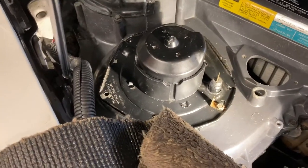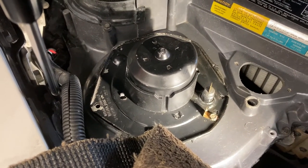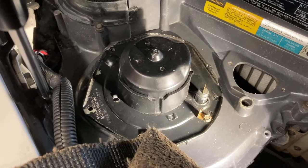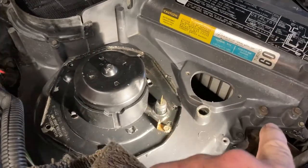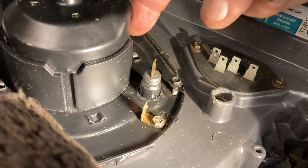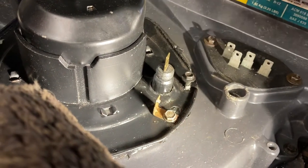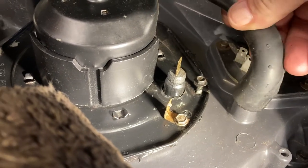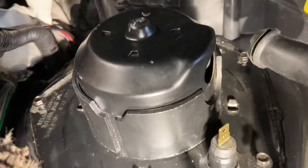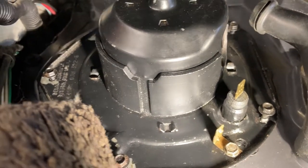So let's get those mounting screws in. And were those sevens? Yeah, I think they were. They're very coarse screws. And then we'll get the resistor in, and the relay, and the other brackets in. Let's not forget that there's another reason we pay attention to that ground peg. There's a plastic peg, and that's for our cooling hose. And look, there he is, right there. So we do have to clock this in a certain place.